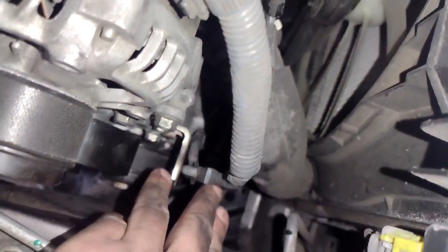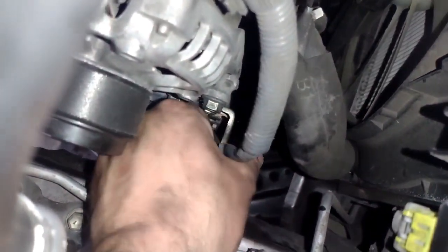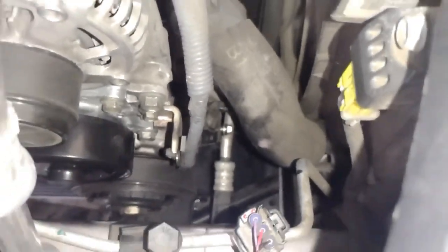We'll slide this wire harness back on. You want to make sure that your wire harness is put back to where it was as best as possible, because you don't want it to get caught up in your belt or hanging loose or anything like that. Weird stuff happens in cars under the hood when you're on long drives, so just try to get it back as exactly as possible. And then here's that 10 millimeter bolt down there that I had to take off when I was going to put the water pump back in.